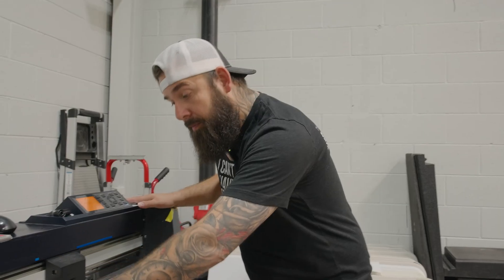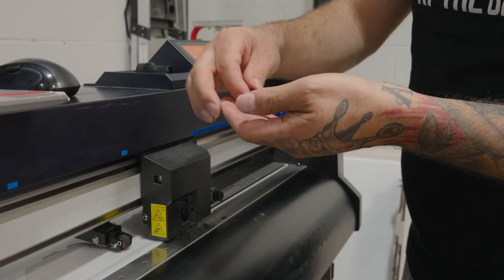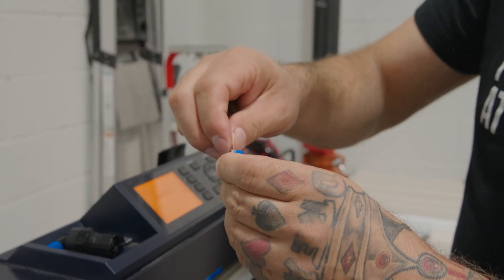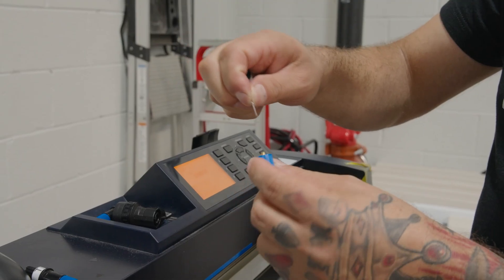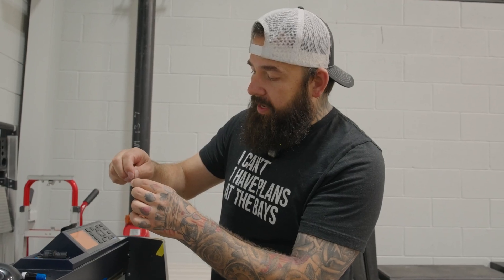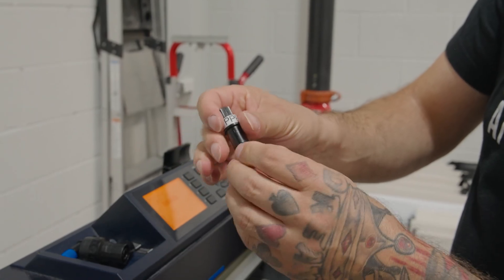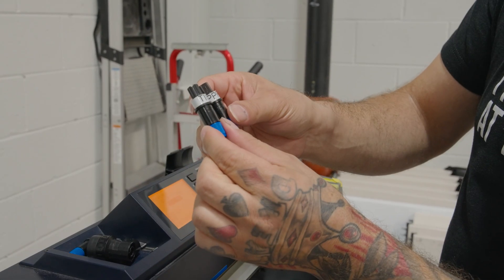The first thing you want to do is set up your needle in your blade holder so your blade goes inside here. You open it up — this is where your needle goes — and there are separate needles for paint protection film and window tint. Once you put your needle inside your blade holder, put it in there, tighten it down. We have actually labeled our two different blade holders here: one is for PPF, one is for window tint.